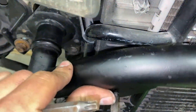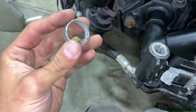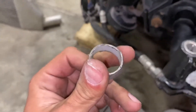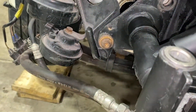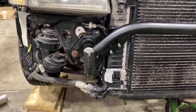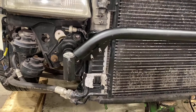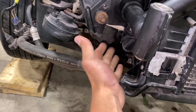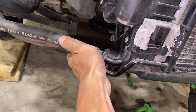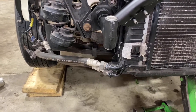Okay, back to this — before it was notched, so I didn't crush this AC line, I had to run spacers behind here, which I clearly rigged up. I didn't want to do that, obviously that's not how the car should be. So now that it's notched, that should sit flush, and I'm going to try to get my bumper mounted with the front mount and see how it all works. I cut this plastic out and bent these AC lines back just a little bit, and it should clear.